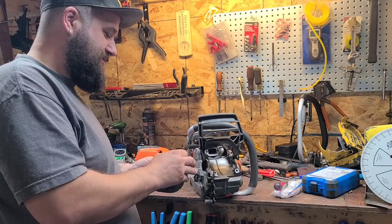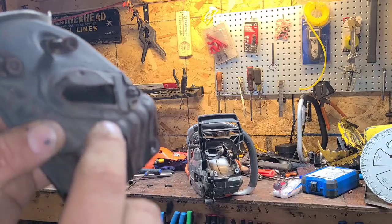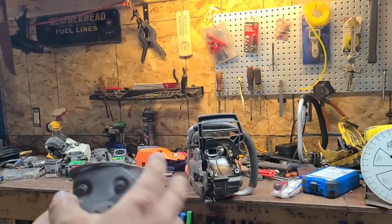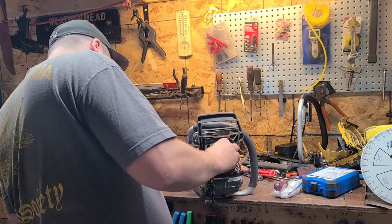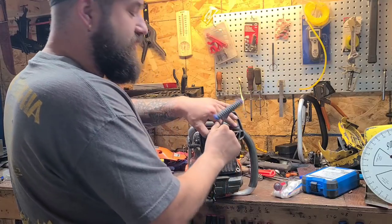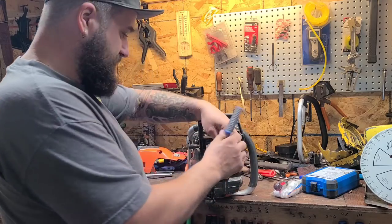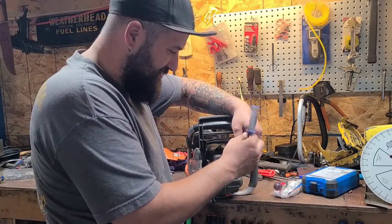You guys asked about the muffler mod on this. See that dark spot there? I put an extra hole which basically bypasses — right there, that's the stock outlet — I put an extra hole in there. It keeps it running cooler. I still really want to port this saw and put a pipe on it because these things run too hot. I can't think of a better running 60cc saw period, in my opinion. This thing's an absolute screamer — you keep it on the pipe and it will pull a long bar. I'd like to put a 32-inch on this someday.